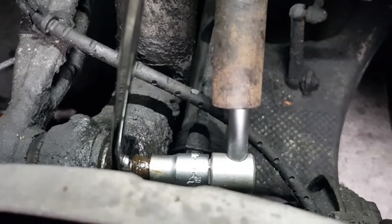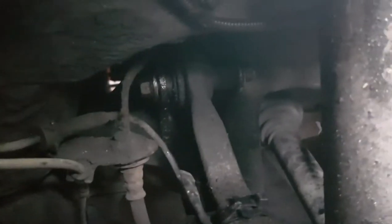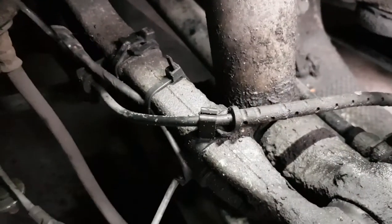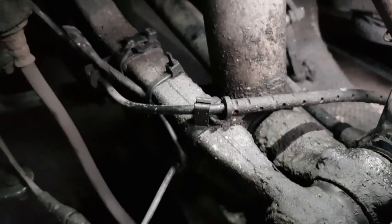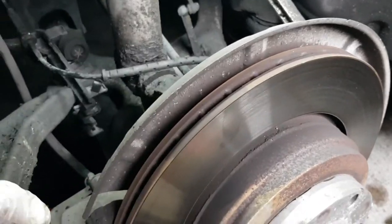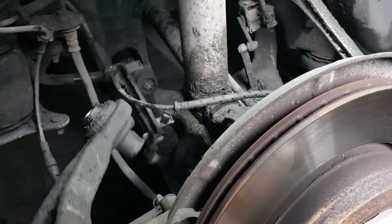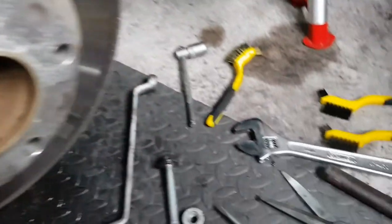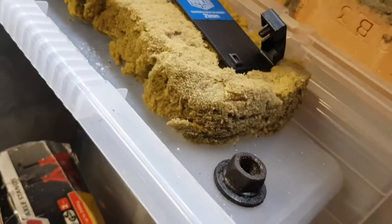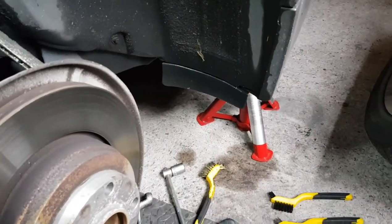That's everything loose. Basically now it's just a case of undoing that nut all the way until it's off, undoing that nut all the way to pull that bolt out, unclipping those, and the arm should just come straight out. I'll come back shortly. The new arm is going to go in under here, up in and in there, but I'll clean it all out properly before I do that. I'll tighten it all up — they'll reuse this and this. The old nut that came off the ball joint I'll keep, but I'll not reuse it here because a new one came with the new part. I'll start putting that in and then come back to you.